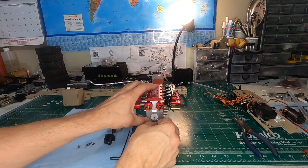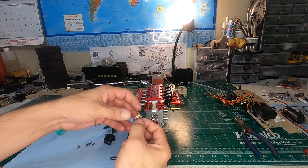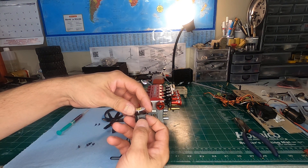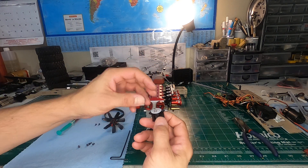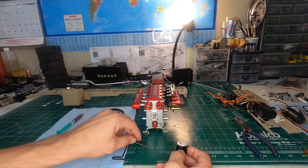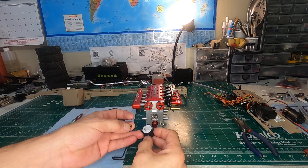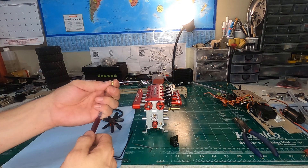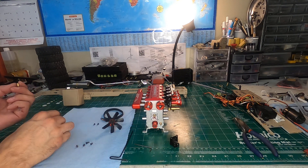I'm going to go in here and pull out the gear itself, which will bring the Teflon washers and spacers out. I've got both of my spacers — I don't want to lose which way I had it in. It's kind of hard because there are raised portions, and that raised portion is where it was facing the engine. No damage inside, the gear looks good, everything looks good. I've got about two gallons of gas through this engine and everything is looking very positive. I'll put a little assembly lube in there to keep everything nicely lubed up.